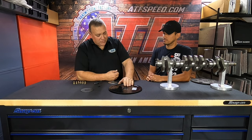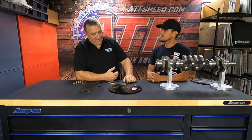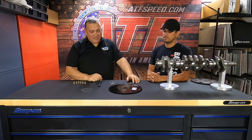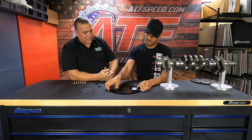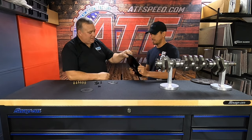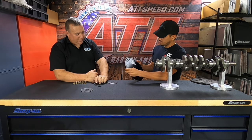This is our second design flex plate — we just had it SFI recertified a couple months ago. They actually contacted me and said we had one of the strongest flex plates ever tested. The first time he tested it was 200,000 tensile strength — he said you only need 30 to 40. He tested it again, it came out over 200,000, so he had to call and find out what metal it was made of. We now know we can run these to 2,000-plus horsepower without any failures. The earlier ones had metal that was a little soft and bolts would loosen up. Now the metal rings when you tap it — when you torque the bolts it doesn't smash the steel and loosen over time.